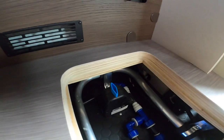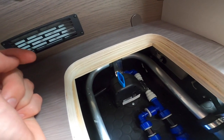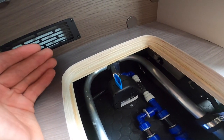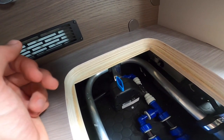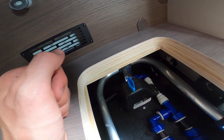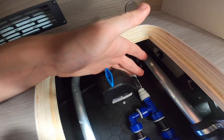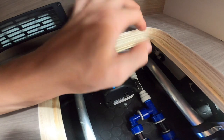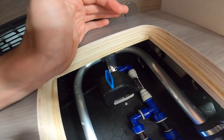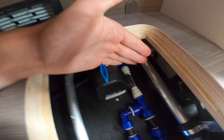this is very important. This is your anti-frost control, which controls your boiler water. So in the winter, it's very important that you drain the boiler off. Otherwise, if the water was to freeze in the boiler, it's not covered under warranty and it's very expensive to repair. But what this does is it drops the water automatically at 3 degrees. But don't rely on it, because you don't know if it's ever going to become faulty. And if it becomes faulty and you're relying on this, then you're going to have an expensive mistake.